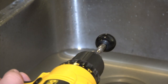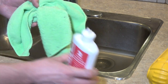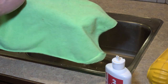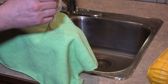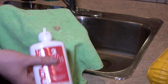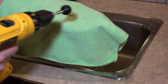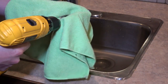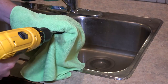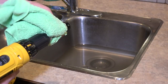After a quick rinse, wrap a small wet strip of the 2000 grit around the metal shaft and spin it to a polish. Alternatively, you could use a metal polish depending on how much corrosion you're dealing with. When you have it nice and shiny, give it another good rinse. Finally, after drying it off, we're going to use some Novus II and a microfiber cloth to give the ball top a nice shine. If you can't find any Novus II, this can also be done just as well with some automotive headlamp polish. Apply a fair amount to the cloth and give the stick a good spin with some pressure to build up a little bit of heat. When you're done and you like the way it looks, give the whole thing one last rinse and dry it off.